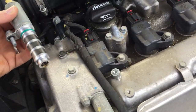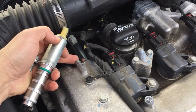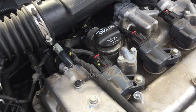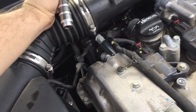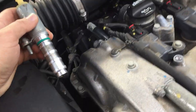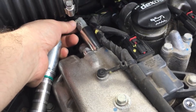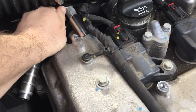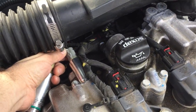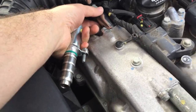That's how you differentiate the two. To change the intake solenoid valve, you just have to remove this 10 millimeter bolt right there — I didn't even have to remove the air filter or the top cover. You just need to remove the 10 millimeter bolt, and on the wire connector you pull this white snap up, press it down hard, and pull it out to disconnect it. Once you remove the bolt, you pull the valve out.